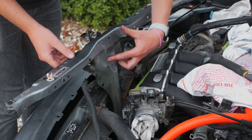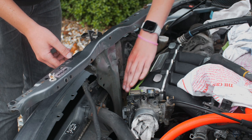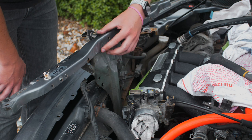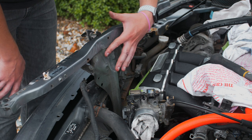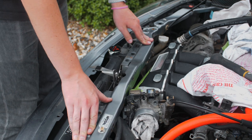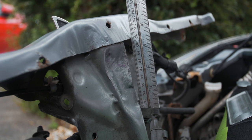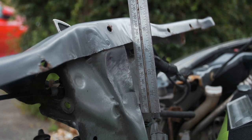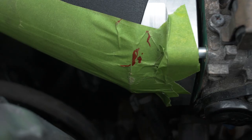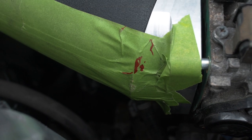As you can see, this whole piece has been dented back on both sides because it was hitting on both sides. This bit here is hitting where the stud that mounts the throttle body is, so we've bent it back for clearance. With a ruler you can see we've dented in about 90mm down. It's a trial and error thing - you just keep knocking it back until it fits. The red marker shows where we marked the area that was hitting.